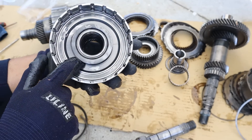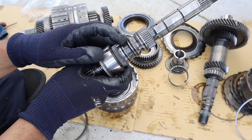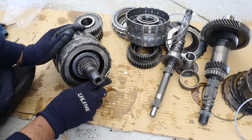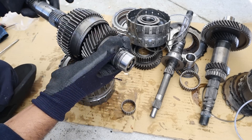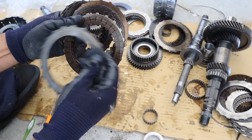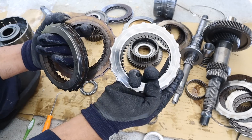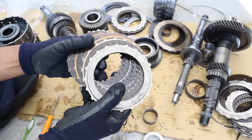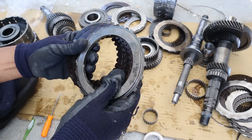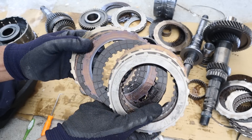Taking a look inside here you can see small holes — that's how fluid is transmitted to the piston. There's a piston on one side for fifth gear and one on the other side for fourth gear, pressing up against the clutches, activated through these holes as fluid is carried through the shaft. Here we are with second gear — this was also a very common clutch to fail. Taking a look at second gear, the friction discs themselves didn't wear out, but the steel bands show significant discoloration compared to steel from a previous gear — that's how it should look versus all that discoloration. This tells you two things: either this clutch was overheated due to lack of lubrication or oil starvation, or the clutch was always being applied and forced to slip due to a defect in the valve body or control system.